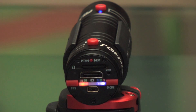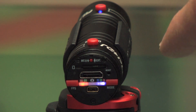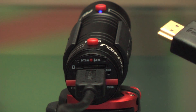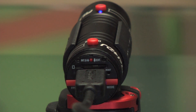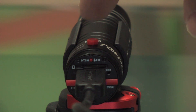If you want to view the files off of your camera, make sure that your Replay XD 1080 is turned on and your SD card is fully inserted. Once it's fully inserted, you can plug in the HDMI connector into the back of the camera and plug the other end into your TV or monitor. Once it's in thumbnail mode, you can simply press the power on/off button to cycle through each thumbnail. When you're on the selected thumbnail, you can now play and stop your thumbnail.